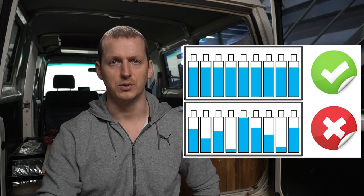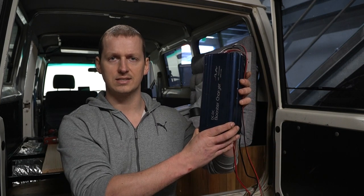This means if, in the unlikely event that I leave the ignition on for a long period of time, the battery charge will balance itself between the two. The alternative solution is to use a DC-DC charger. The advantage is that it avoids the risk of battery balancing. And if you're in that rare event of forgetfulness, you're safe, as most chargers are set to operate only when the engine's running. The disadvantages are that your battery will only charge at the rate specified by your charger, which is typically less than your alternator can charge. You also lose the ability to bridge your battery connections unless you add some more fancy fat cables and doohickeys.